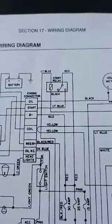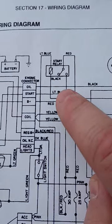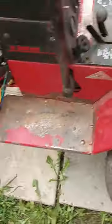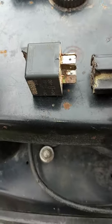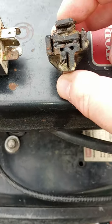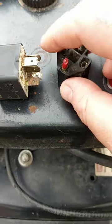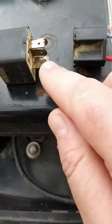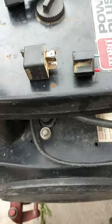As you can tell, there are only a few wires that come off of it. You've got a black for ground, a light blue for ignition, a light blue for the starter solenoid, and a red that's your power going to the relay. What happened here was the relay is actually still good, but over time dirt and debris gets built up in these and they end up getting hot and burning up. What actually happened was the power wire was so melted it was not sending power from the lead wire to the relay — that's all that was wrong. You can buy just the plug on Amazon or eBay.